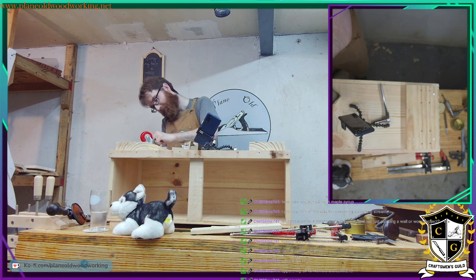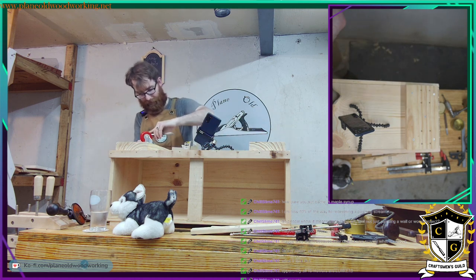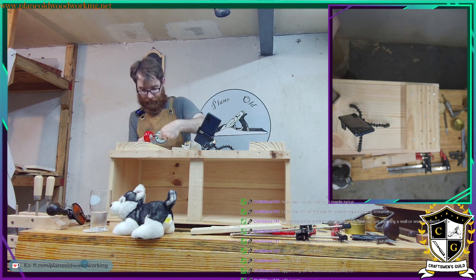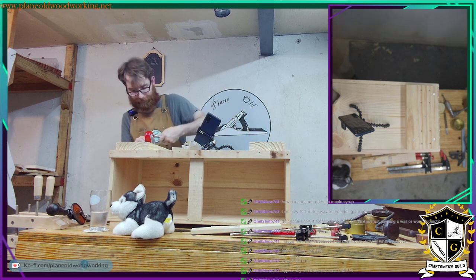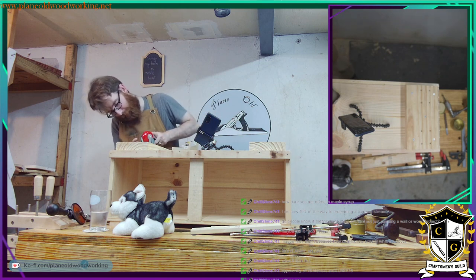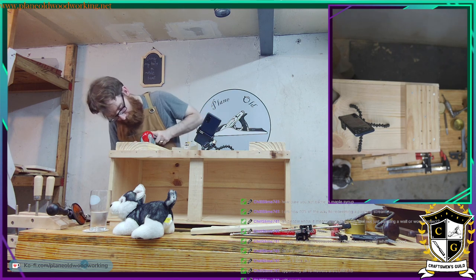Come on. Just get started. There we go. Because until it gets started, there's not enough. I guess I could get the standard socket instead of the long socket, so that there's a registered face, but the long socket is performing admirably, doing exactly what I was hoping it would do. Just bypass the wheel completely. There's about half a mil distance between the socket and the wheel bearing.